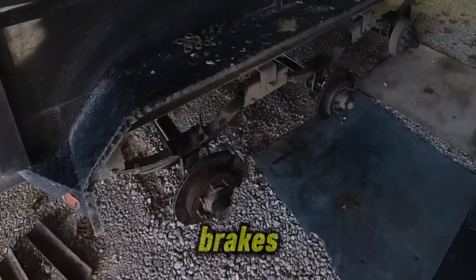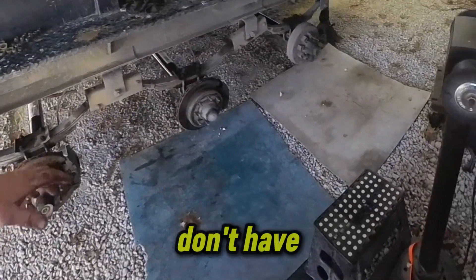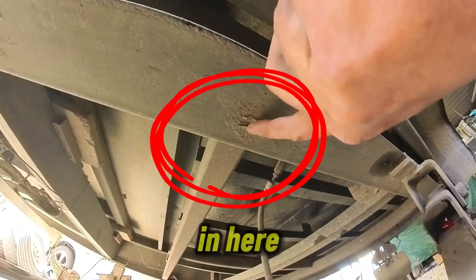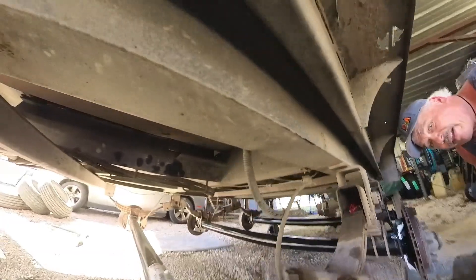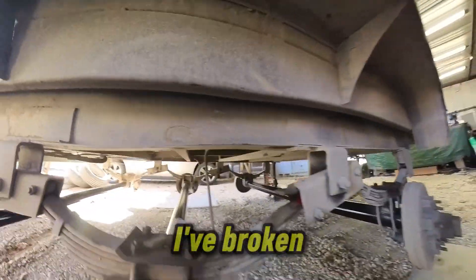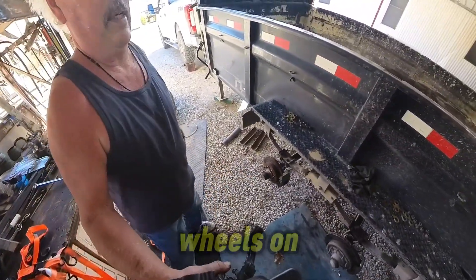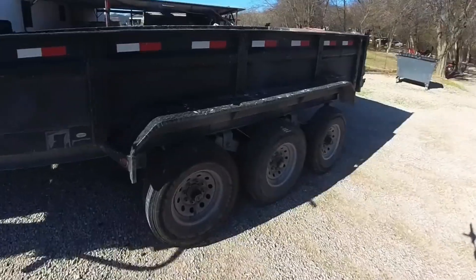Now we've got all the brake rotors and drums mounted. Some of y'all might be wondering why I'm doing this if I don't have an issue with the trailer being too low — my issue is the axle gets too close to the frame right up in here. It's actually dented in where the u-bolt is hitting the frame. It's all the way around the trailer — I've broken many axles and I think that's one of the reasons why. Let me get this thing raised up so I can get the front wheels on, then I'll use the ramp to raise the back end up and get those wheels on too.